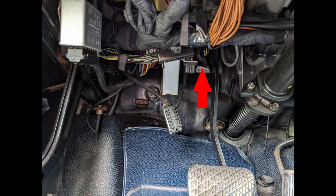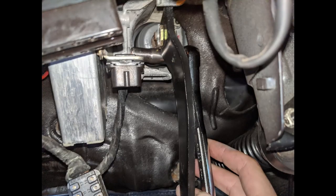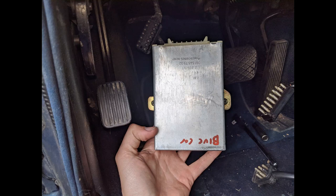If you get in there close, it's kind of a tight space, but you can get in there. Up next to the brake pedal, you're going to notice this little 10mm bolt. With a 3/8 ratchet and a deep-well 10mm socket, you can squeeze up in there and loosen that bolt. Once you remove it, you'll be able to remove the bracket that holds the cruise amplifier in.